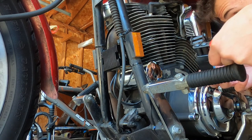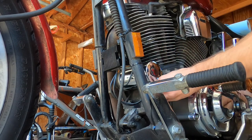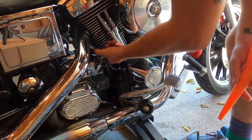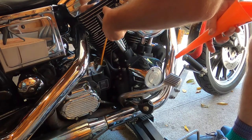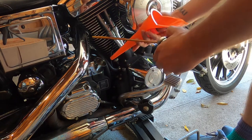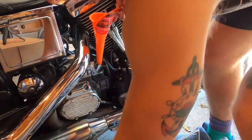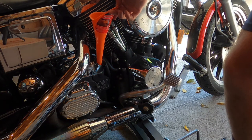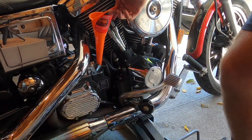I can see that little smudge spot right there. Going a little bit more - there we go. All right, now come around to the other side of the bike and start filling her up. We got our filter on, we're gonna come over to the good side of the bike, admire her in all her glory, pull out the dipstick, shove the funnel in there. I think you can get like three and a quarter quarts in these things - got three brand new ones left, so hopefully that is enough.